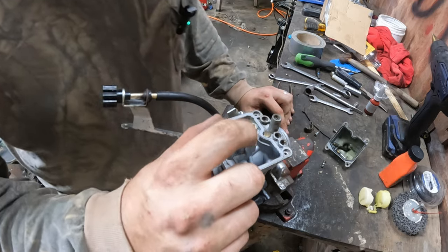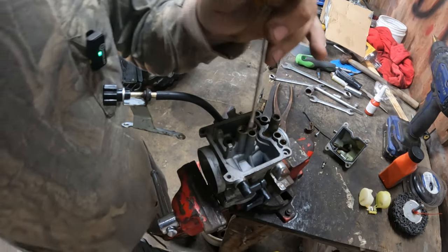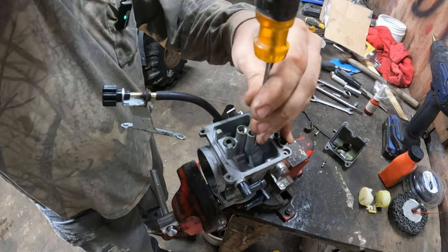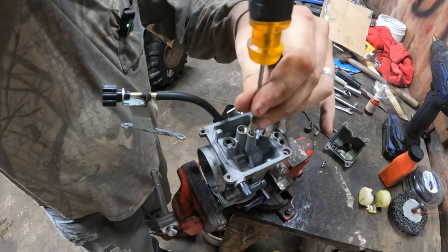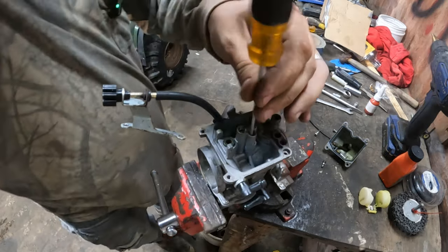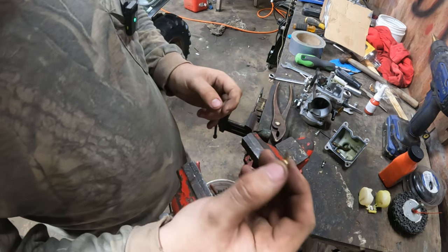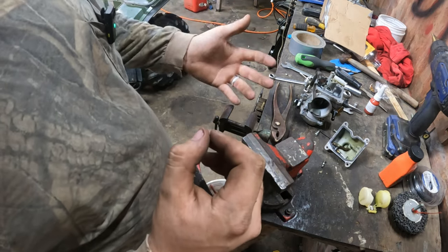Down in this hole I don't usually get these out, but I'll give it a shot — small flathead screwdriver, push it down in there, give it a good hard push and twist, and it came loose. This is an aftermarket carburetor from China that somebody put on here. It's a lot better to go with the originals, but the aftermarket stuff is cheaper than a rebuild kit. A lot of times I've taken aftermarket carburetor pieces — jets, floats — and put them in the original carburetor body, or vice versa, if the original body was rotted out.